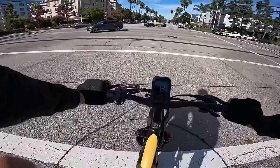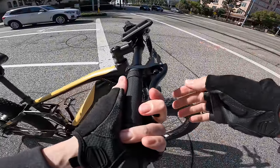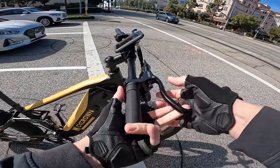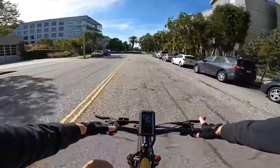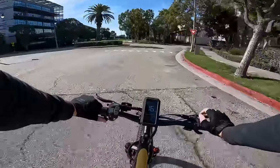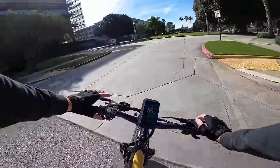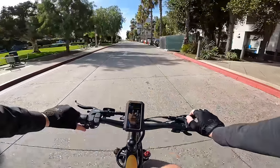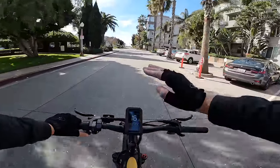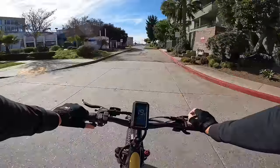Out of the box I'm noticing the right brake — the rear brake — needs to be adjusted a little bit. No big deal, just rotate this screw to get a little more adjustment. Let's pump down to pedal assist two and try throttle only. It looks like this has a tiered throttle response — whether you pedal or use throttle on pedal assist two, it'll take you up to 16 and cut you off at that hard limit. Same goes for pedal assist three: whether pedaling or throttle only, it'll cut off at 20.